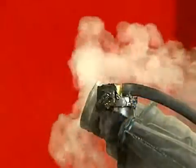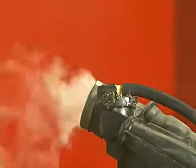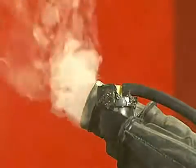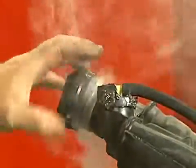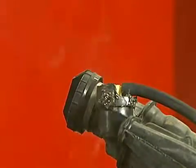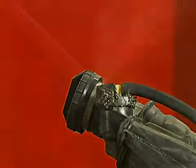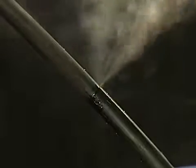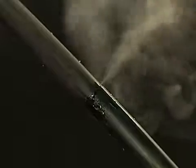For areas in the evap system that are hard to access or to pinpoint small leaks, a smoke generator may be a suitable tool. This method requires pressurizing the evap system with white smoke. Be sure to wait to see smoke appearing from the filler neck area before reinstalling the gas cap and pressurizing the system. For vehicles with low fuel levels or big fuel tanks, allow extra time to fill the system with smoke. With the system pressurized and using a high-intensity white light, the white smoke can be seen venting from a leaking area.